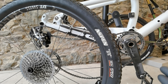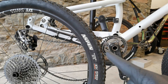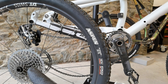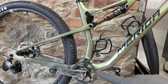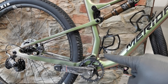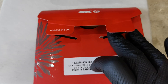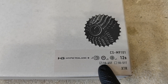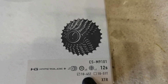If you have one of the most popular setups right now — 1 by 12 drivetrain, this one is 1 by 11 — you will most likely have a 32-tooth chainring. It's very versatile. If you have a cassette like 10-52, 10-51, or 11-50, 32 teeth at the front is very popular. More racing-oriented bikes will have 34 teeth at the front, as it says right here: 34T. But I'm replacing it with a smaller 32-tooth one — because I'm replacing the cassette from 10-52 with a 10-45, so I need a lower gear at the front.